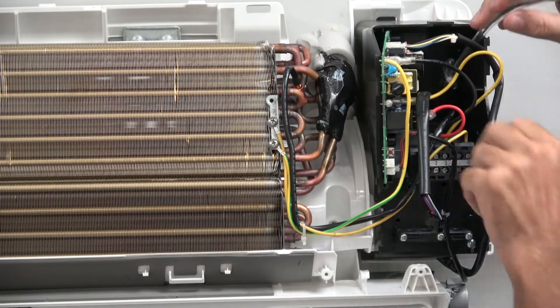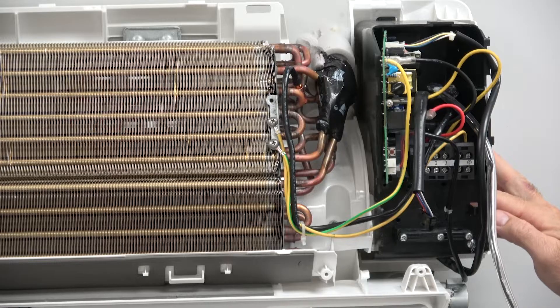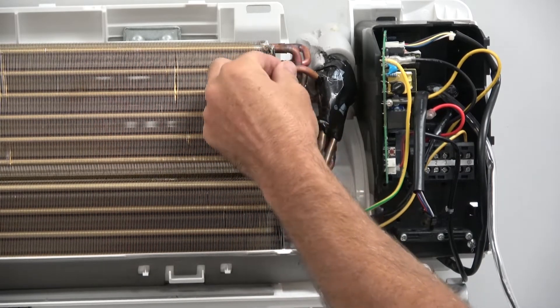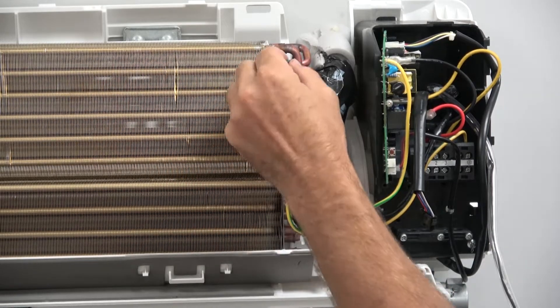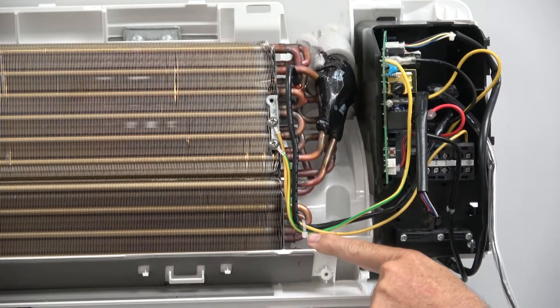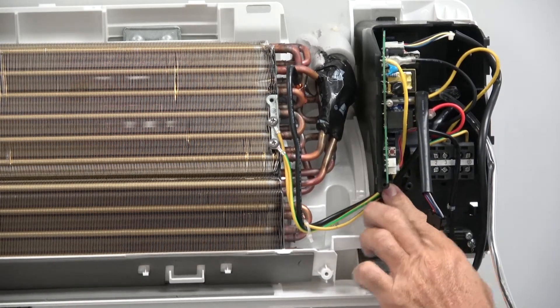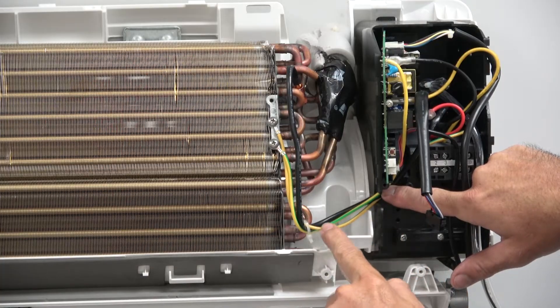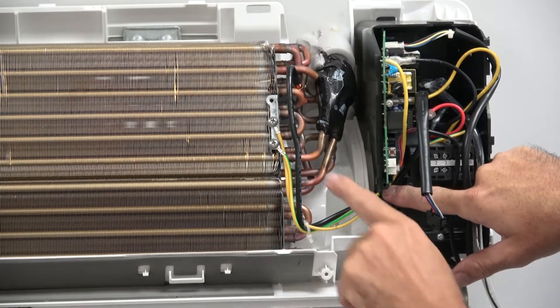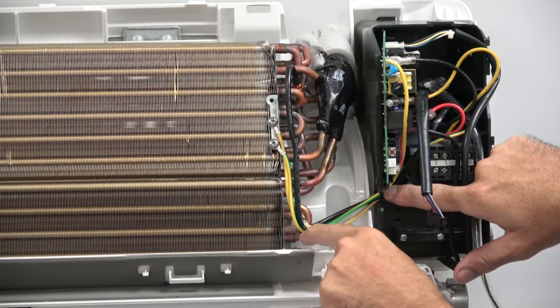If you need to replace the assembly, or if you need to get to your indoor fan motor for cleaning service-wise, it's pretty simple. The only thing you need to remember is to unplug your coil sensor and then your grounds. These are connected by a zip tie — this zip tie is very important. Make sure the zip tie goes back in the exact right spot and your wires are angled properly. The wires go in this hole, and if you notice, the wires the whole time are dipped down and above the drain pan. The reason being is these things sweat and the water can go down on the wires and will get to the lowest spot and drip.